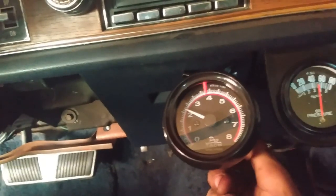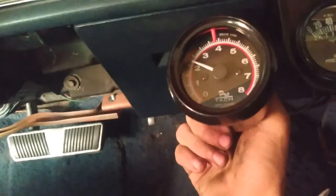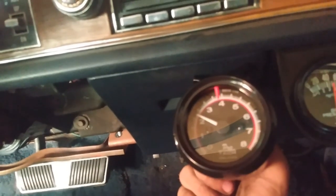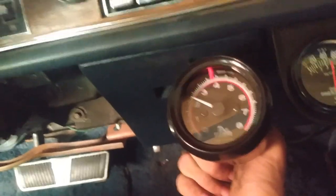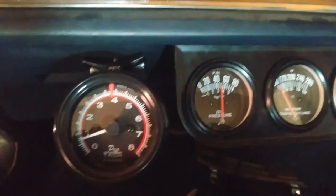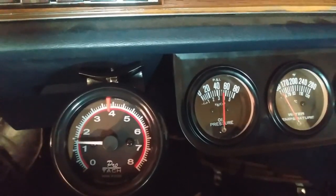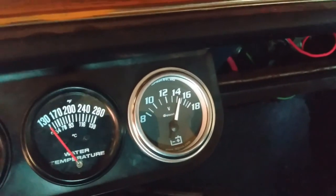I know that ain't 2 grand. I think it's adjusted for these tachometers, they can go anywhere from 4 to 6 to 8 cylinder engines. Probably didn't check on the 8 selection, so hold on. There we go, that's more accurate. 800 to 900 RPMs. And we are charging.